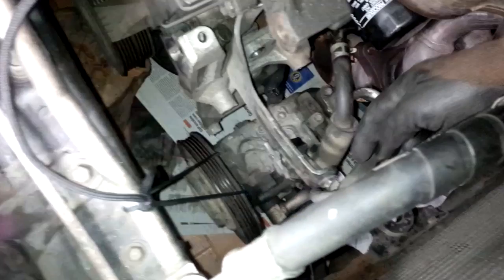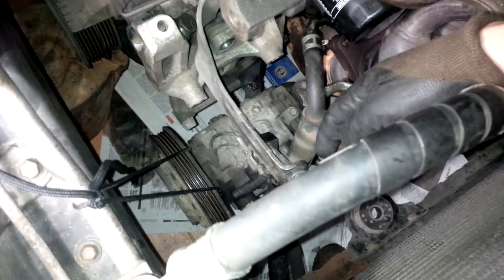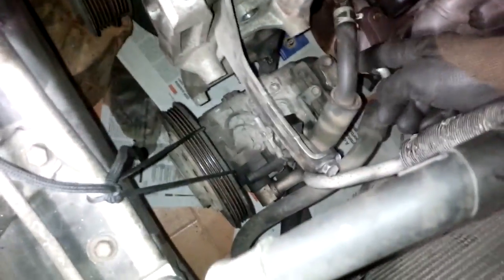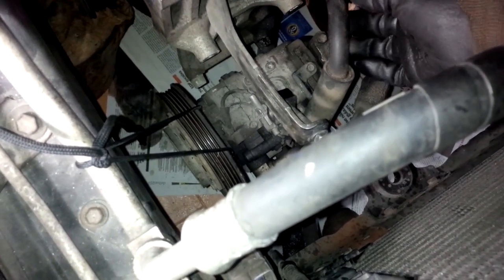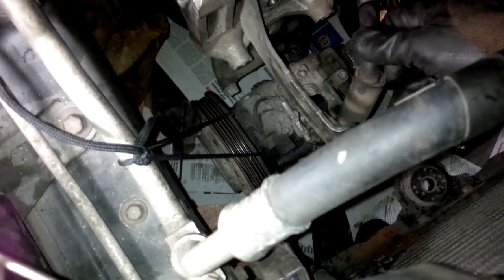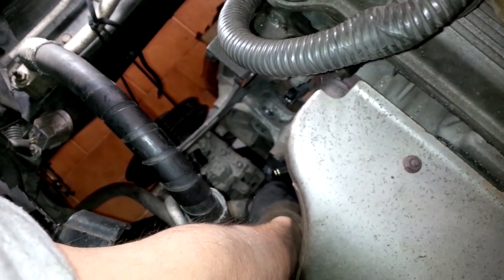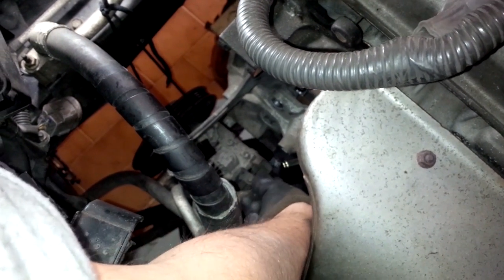It is time to remove the oil lines that run to the oil radiator. You see there is one here, and then one on the oil sump. Just remove these clamps and remove the oil line. Engine oil will come out when you remove these hoses, so be sure to have a pan ready underneath.